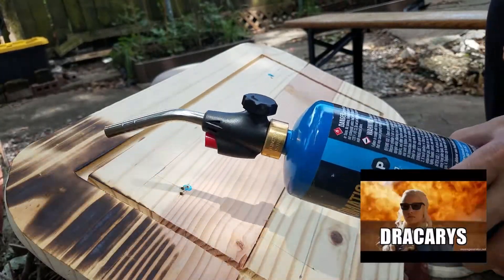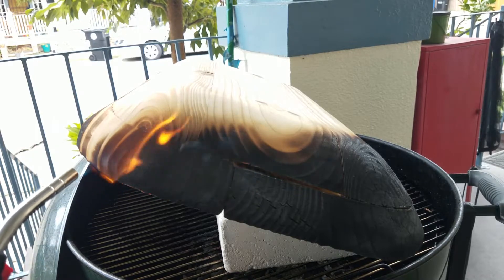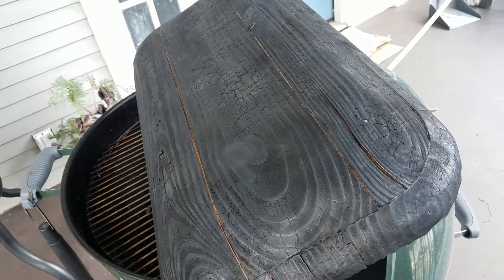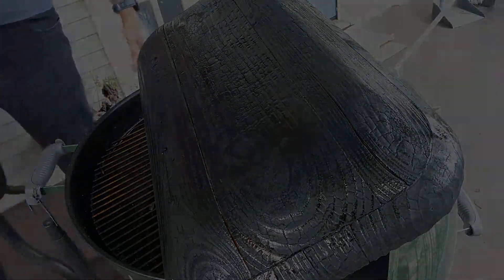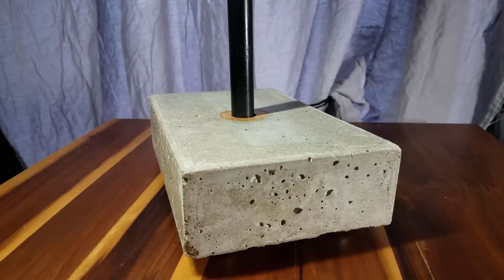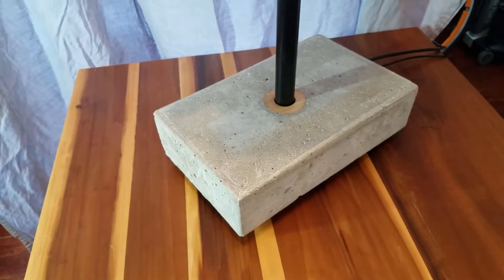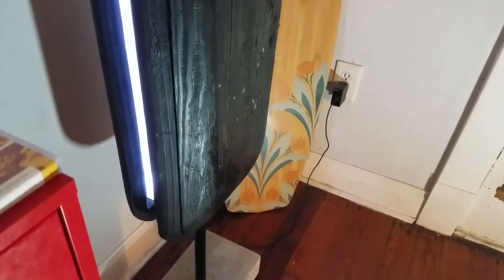For more fire — that was pretty corny. Overall I'm pretty happy with how it came out. That wooden ring accentuates the connection really well and I love the texture and the contrast between the materials. Hiding the wires in the pipe kept the design clean and decluttered. The standoff feet elevated the base enough for the wires to move freely. I love when aesthetics and function come together nicely. Happy to report, there are no issues with thermals — temperatures stay below 70°C under heavy use and about mid-40s under normal conditions. It currently sits next to my TV and it looks really clean.